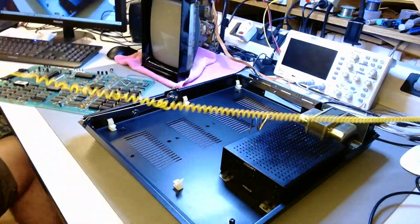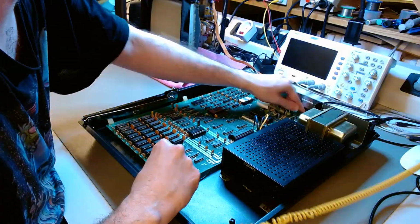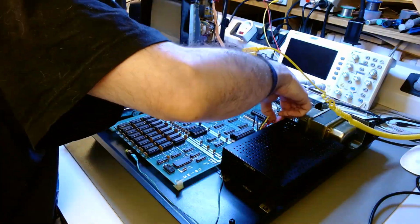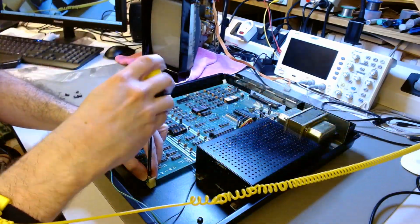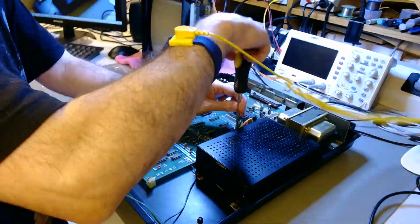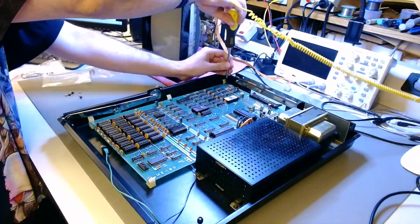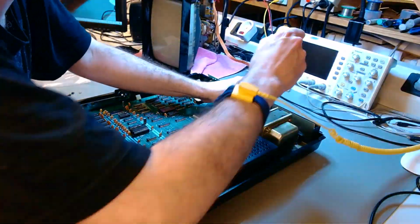Now I begin reassembly. First I dust off the case, put the motherboard back with the flux varnish layer already dry, reconnect the power supply. Now I'm putting the screws, because this is the final time, hopefully for many years, the motherboard is going to be affixed on its standoffs.